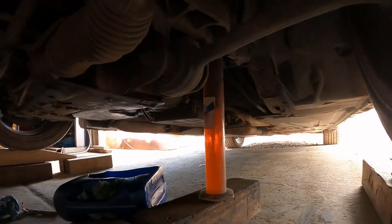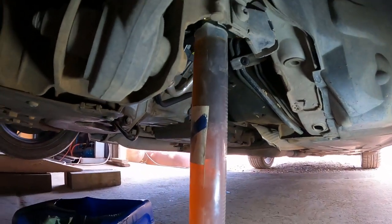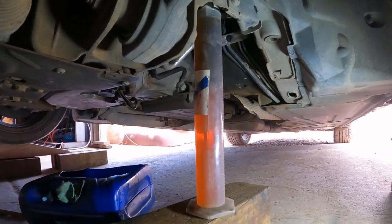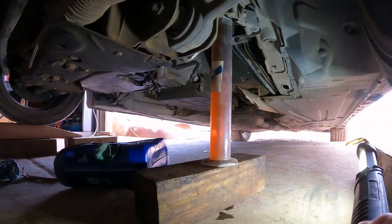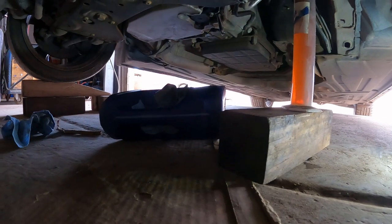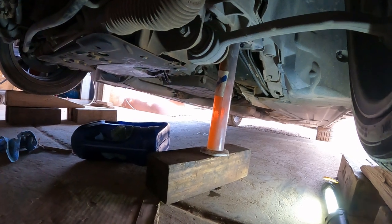This is my setup here because I got tired of it. I measured everything and can't find an electrical fault. I put the original sensor back into this tube, starting by just dipping it in, then filling more and more until it's completely submerged — and it doesn't change the readout. It's always two quarts low. Let's switch to the new aftermarket sensor and show you the message with that sensor.